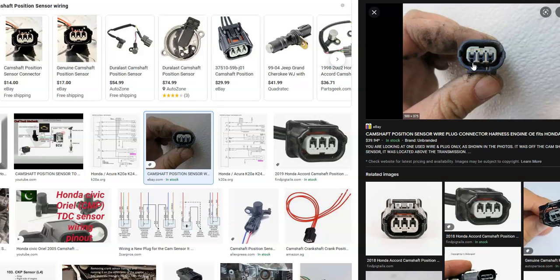A common method is to take the connector off and attach a known good cam sensor to the harness, coming in from the back — measuring from ground to the return wire to the ECM. Put a piece of metal in front of the sensor, because the sensor completes its circuit when metal is directly in front of it. The value on the meter will go from about five volts to zero volts depending on whether there's metal in front of it, and that will tell you whether the whole circuit is working.